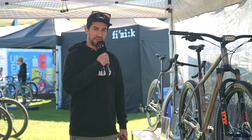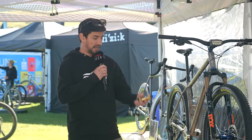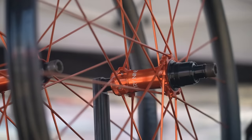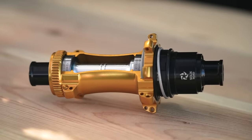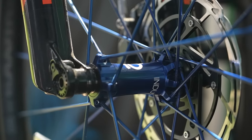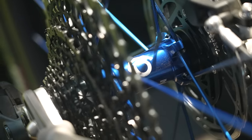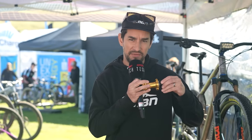We're under the Industry 9 tent, and they've got a very cool new house titanium hardtail here. What I'm here to take a look at is this brand new Industry 9 hub called the Solix. You may know Industry 9 for their Hydra hubs. This is by no means a super lightweight, but it's a paired down version of that - still got a lot of strength to it. It's available in a few different builds from gravel up to XC and trail, up to sort of the 140mm trail bike. Available in three different spoke options: lightweight gravel spokes, straight pull aluminum Industry 9 spokes, or a more standard J-bend spoke option. They've got super quick engagement like their Hydra hubs - about 0.5 of a degree - and makes that lovely sound when you're spinning along.